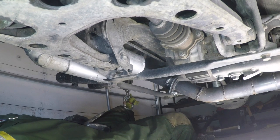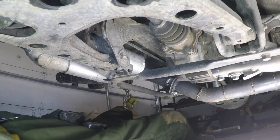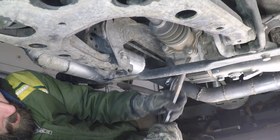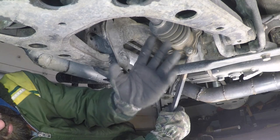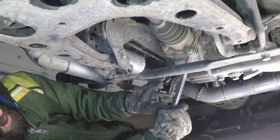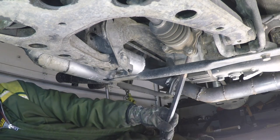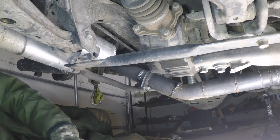With the e-brake off and out of gear, you can spin this around however you need to, to make it easier to pop off. Now if these are being a pain in the ass and you have two-piece axles, go ahead and drop the nuts and bolts off, get the axle out of the way, and you can pull these ears off later. Just with the differential mounted to the car, it's a little easier to pry on these. And then you can just pop it right out.